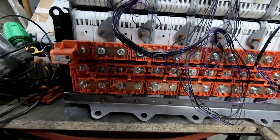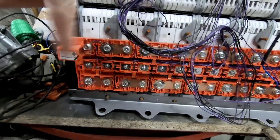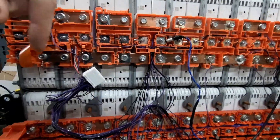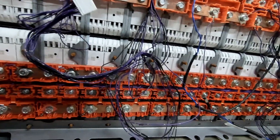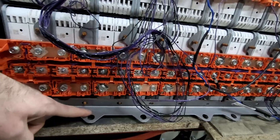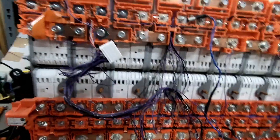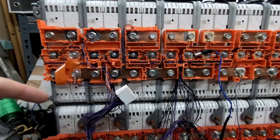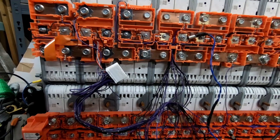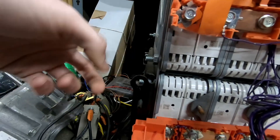So what I'm going to do is undo all of this and take it off. This is the set of contacts that is all in one piece, rather than the one I built up here where I had to construct it from all over the Leaf pack. So I can just take this one off in one go and put it back together, and that shouldn't be too hard. What I'm also going to do is take these mounting brackets — there are two of them — and bolt them in just to try and hold the pack a little bit closer together. I'm also going to leave the upper pack intact, so that should limit the amount of expanding that happens, and then we'll just undo all the bolts, take these guys off and bolt it back together.